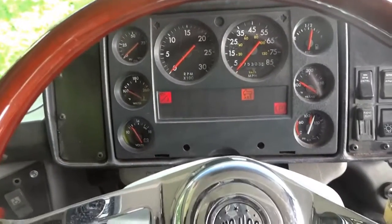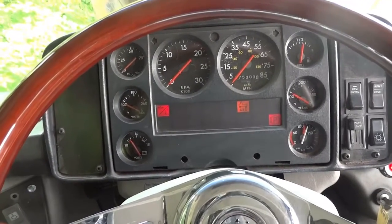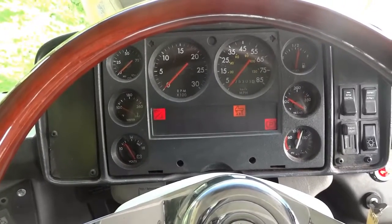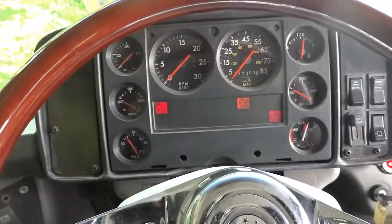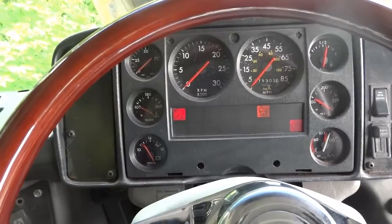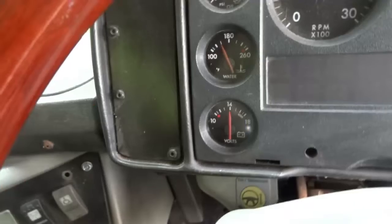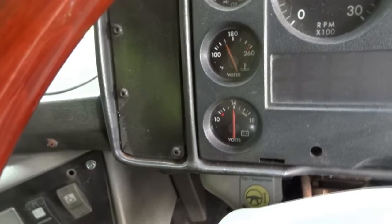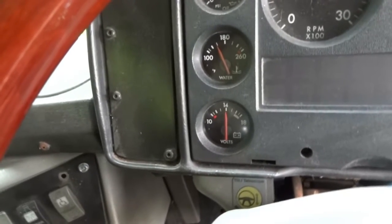So what do you guys think the issue is? It's pretty simple — the engine temperature sensors, our ECTs, are defective. I always like replacing both of them. You could also have a sticking thermostat causing this, but a sticking thermostat would not cause a high temperature reading on the dash while the engine is completely cold. I had to let this bus sit overnight and take these measurements the next day. This confirms to me that the issue is just the engine coolant temperature sensor not reporting properly. One sensor reports to the engine control module, and the other one reports to the cluster module — so both of them will get replaced.